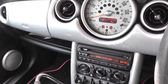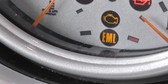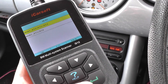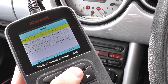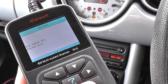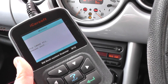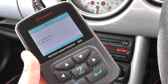Right now we are in our BMW Mini and we do have the engine warning light showing on our dashboard. What we're going to do is diagnose that using the iCarSoft i910 multi-system scan tool. We'll select our vehicle, then select the driver option which gives us access to the engine electronics. It's a petrol model, so we click on DME for the petrol, and it's now going to connect to the engine module ECU.